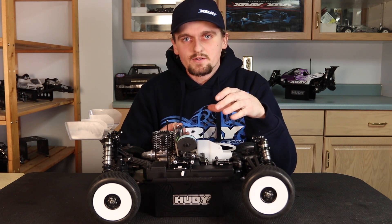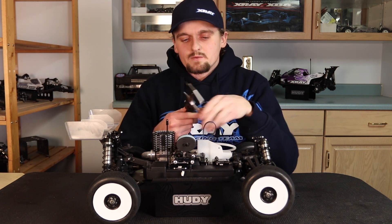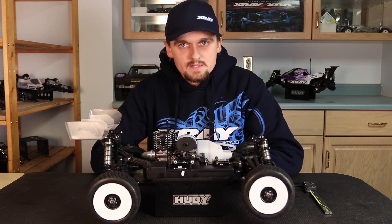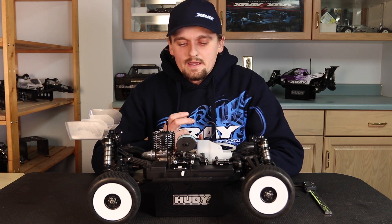Then I'll take my radio and open the carburetor so the calipers read whatever venturi I'm running — that's how I'll start. For example, if I'm running a 6.5 restrictor, I want it to open 6.5 millimeters. Once you've done that you can run on the track and get a feel for it — if it has too much power for a particular track, you can always turn the opening down a little bit.